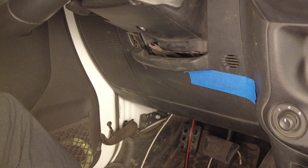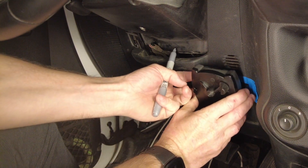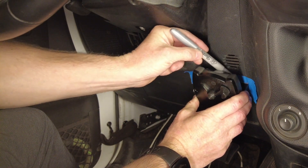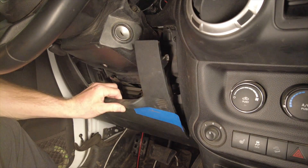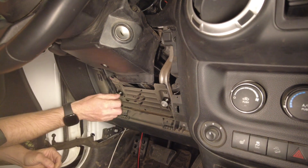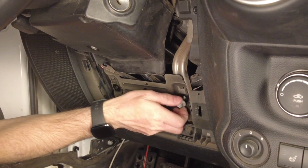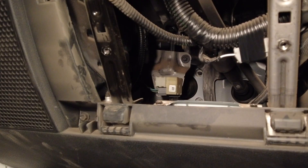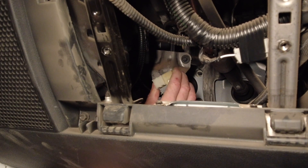I want to install the brake controller underneath the steering wheel. I'm going to put on some blue tape, mark where the top of the bracket is, and then take the panel out and mount the brake controller to the panel. The panel simply comes out by pulling it and hinging it downwards. While the panel is out, we're going to remove this cover so that we can get to the brake switch more easily — take out the two screws, then lift it up and pull it out. With the panel out of the way we can get to the brake switch. To make it easier to work, we're going to dismount it, reach in, turn it counterclockwise and pull it out.